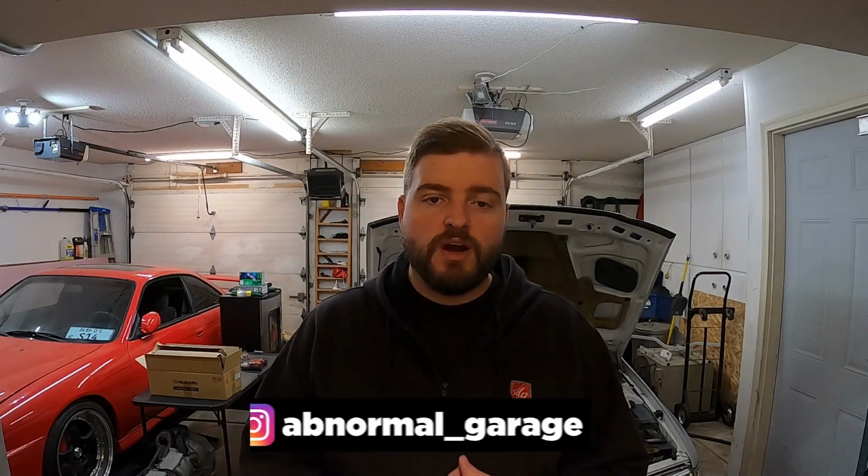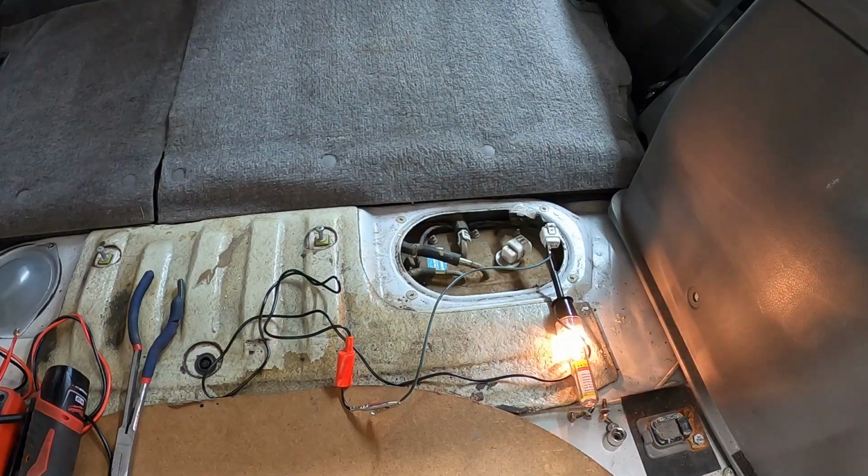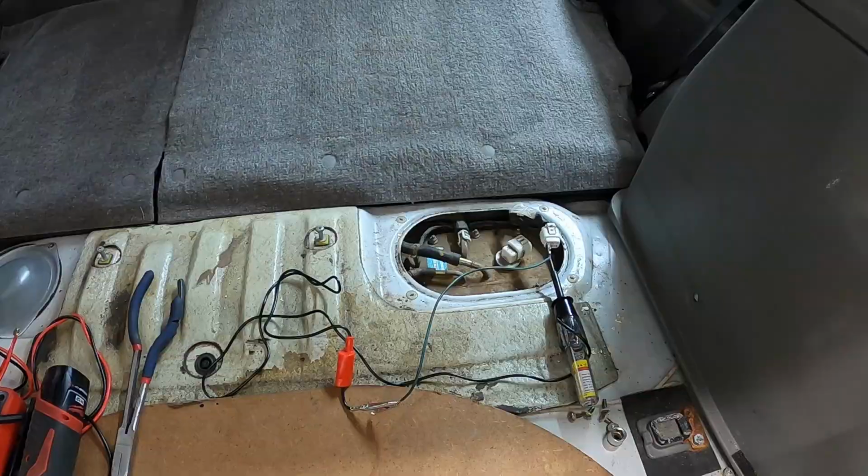What's up, everybody? So today we're back in the garage with the Subaru. Now last video you guys saw, we brought the car in, we kind of reintroduced it to the channel, and we tried to diagnose the issue as to why it wouldn't run. So we started here with the engine bay, tested the fuel at the beginning of the filter and at the end of the filter to see if we were getting fuel to the rail itself, and we weren't getting anything. We could hear the relay click, and we could see that we were getting power to the fuel pump itself, but nothing was happening. So we came to the conclusion that our fuel pump was faulty.